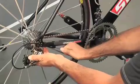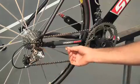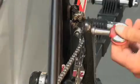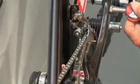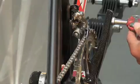Now, pre-stress both front and rear cable systems and retension and refix if necessary. Using the front shifter, shift up to the big chainring. Adjust the limiter to facilitate accurate shifts, but also to prevent moving the chain too far outboard.